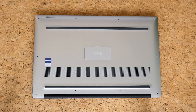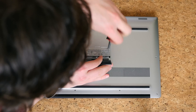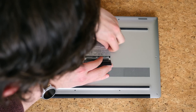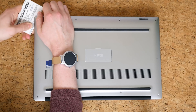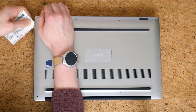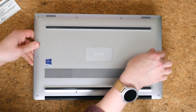The process is very simple. You'll just need to unscrew all 10 of the T5 screws using your Torx screwdriver. Once that is done you'll need to pull open the metal XPS flap on the back to reveal two Phillips screws. They're pretty small so a small screwdriver is recommended to avoid stripping the screws. I used a rather large screwdriver and was able to unscrew them without stripping — just be careful. Now you can start lifting off the back cover. You'll need to use a plastic scribe or a thin plastic card to undo the top portion, which is held in place by two little clips. There may be a little snapping noise since there is a clip that you will need to unhinge.